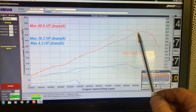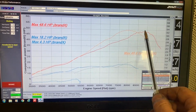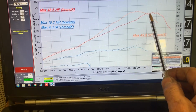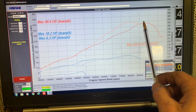So one thing I'm going to focus on this time around with the 2020 model is just extending this over rev. There's a number of ways. It's fairly straightforward to do that, just through ignition and fueling. So I'll definitely aim to match some of these gains that the stock 2020 model has in over-rev. I'll definitely be aiming to extend this here.